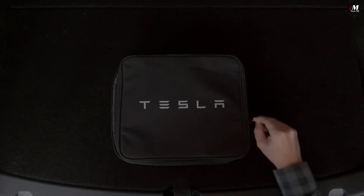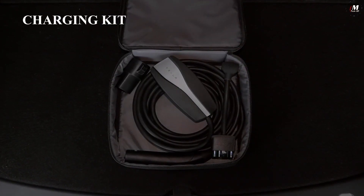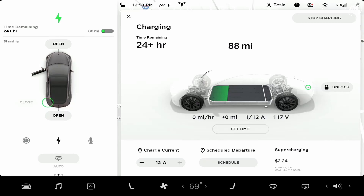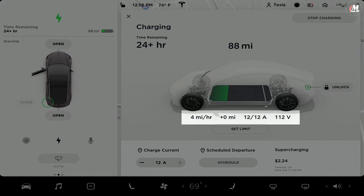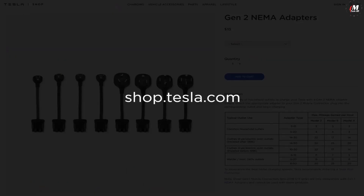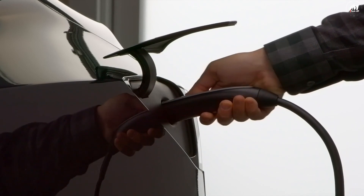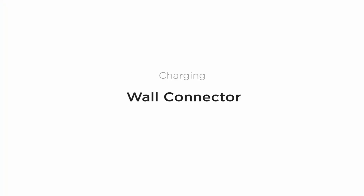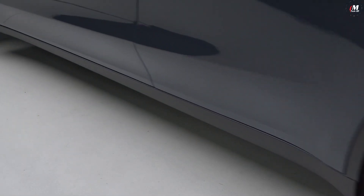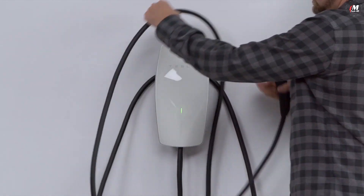This is your charging kit. Inside, you'll find your mobile connector, which allows you to charge your Tesla anywhere there's a power outlet. A standard 110-volt outlet charges your giant battery relatively slowly, so we don't recommend it as a primary charging solution, but it's nice to keep the connector in your car. You can also purchase adapters from Tesla that allow you to use your mobile connector with outlets that deliver more power. A Tesla wall connector is the best home charging option — if you can, just top off every night at home. It takes two seconds to plug in, and your car likes to charge as often as is convenient.